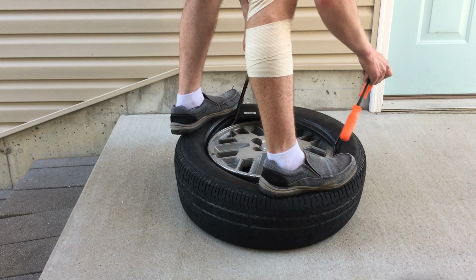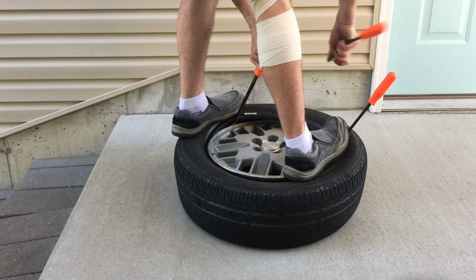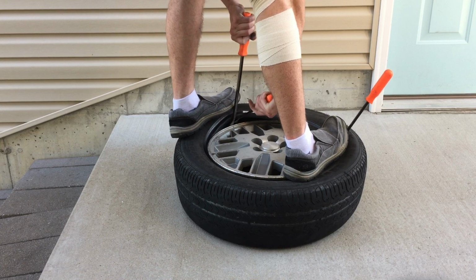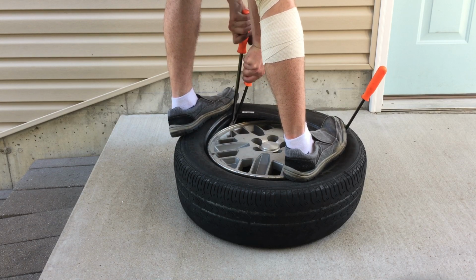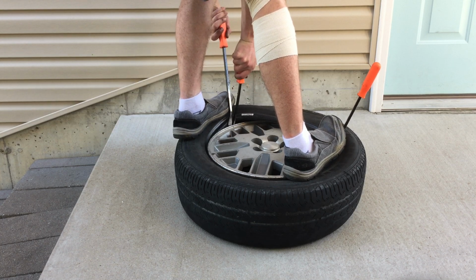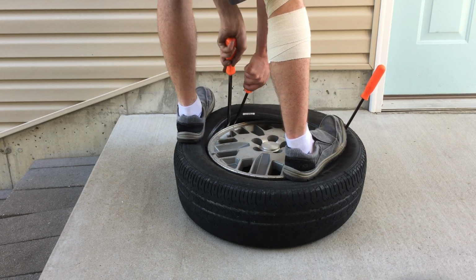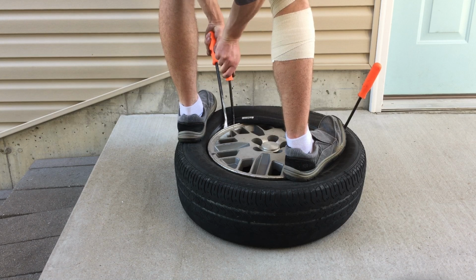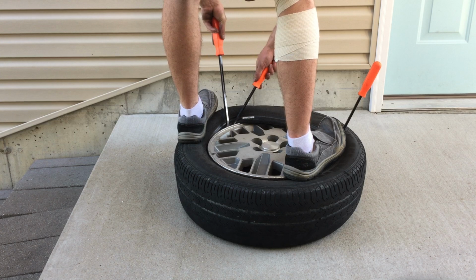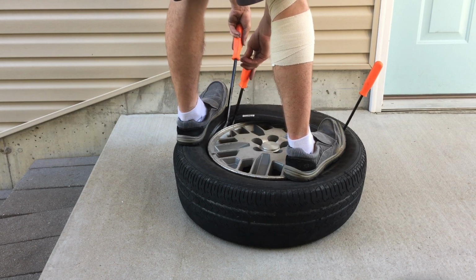Anyway, I'm gonna stop right there, put my foot on this bar so it doesn't flip back, but I don't want to start straining too much, so we'll have 2 bars doing the work over here, just to try and kind of ease the tire on a little better. And that should do this quite a bit nicer. Oh, you can see the dry rot even on the inner lip here. So, again, these are old.